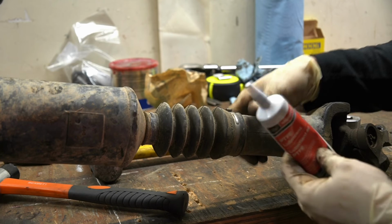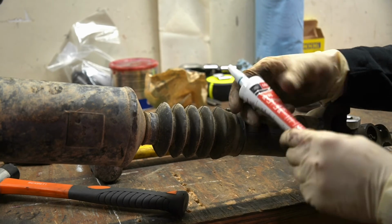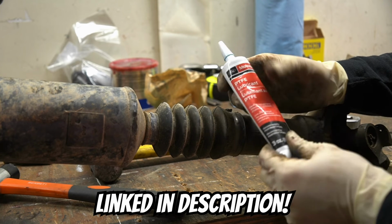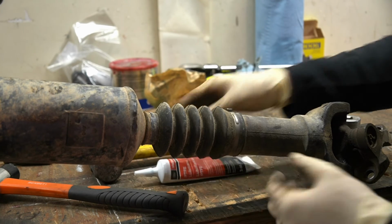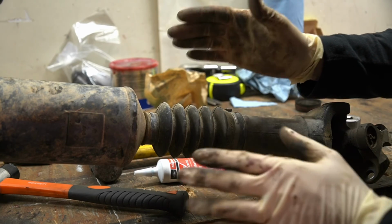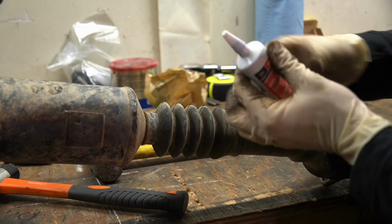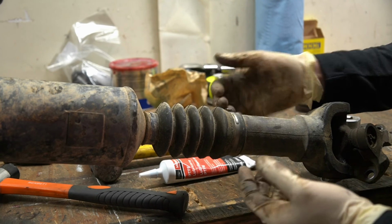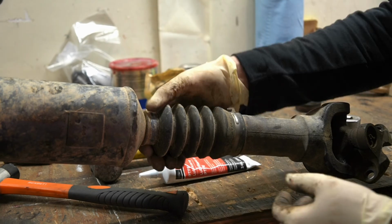As I mentioned previously, the clanking on the drive shaft you'll hear is actually from these splines being dry. And what I suggest you use is actually Ford Motorcraft PTFE lubricant. It's like this nice blue lubricant. I've already done mine recently, so I'm not gonna pull it back apart. Basically, you're just gonna pull one of these clamps off, index it just like you do for everything else on your drive shaft, pull it off, slather a bunch of this lubricant on there, and then reinstall it. You can reuse these pinch clamps from Toyota. It may be easier for you just to get a new one. Take a good look at how they work. It's not too hard just to reuse them.